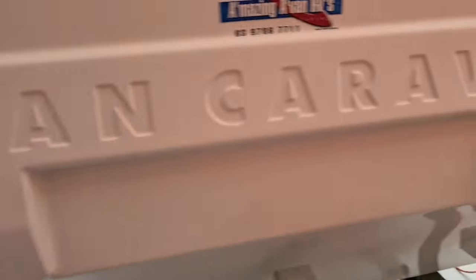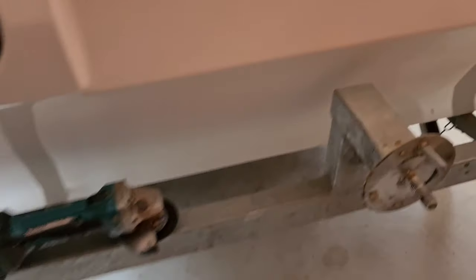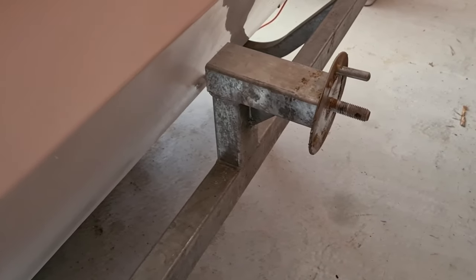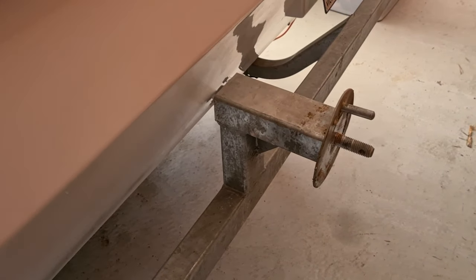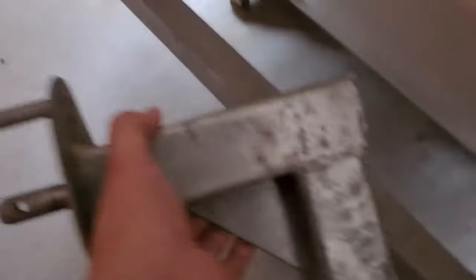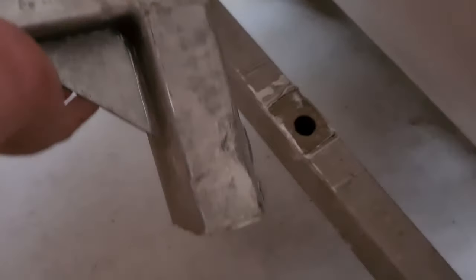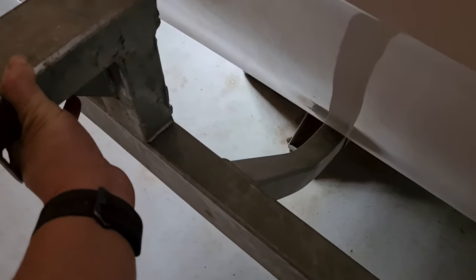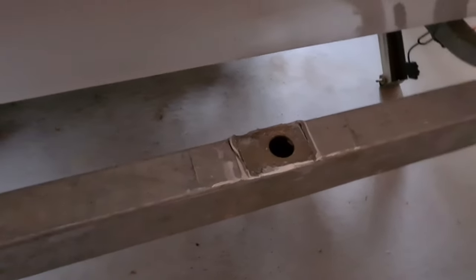I've decided I'm going to take that spare wheel off and mount the box in the middle, central with the caravan — I just think it'll look a lot better. We'll put the wheel to one side. I've got the angle grinder out and we're going to cut around that. I don't have my tools today so we're just using what we've got. Safety first — put your glasses on. So I've angle ground the bracket off for the wheel. I'm thinking we'll reattach it about there, even with that brake light — hopefully it doesn't cover it. I've just tidied this up a little; the main thing is this face needs to be nice and flat, so we'll do some measurements.